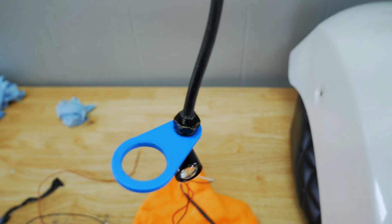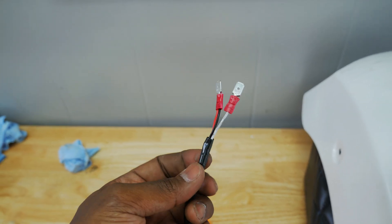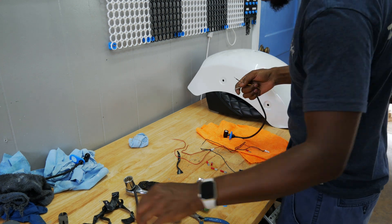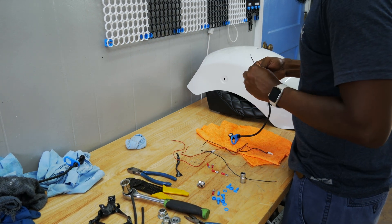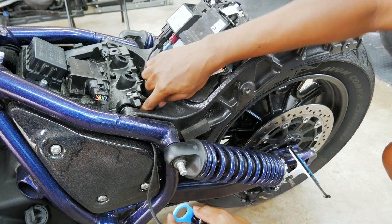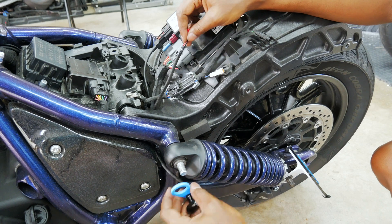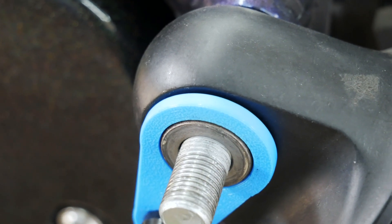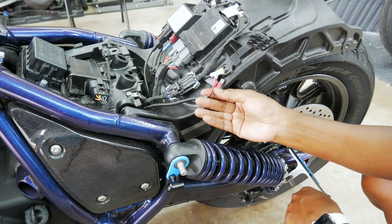The way I'm wiring this up: I'm using the stock Indian harness cover to cover the connector since it's exposed to the elements. Tape them off — red and black together, ground — and the yellow is just taped off in the center. With the wiring done I'll slide this back up through here. Normally I'd do heat shrink tubing and soldering to make it permanent, but I may end up changing these out, so I don't want it super permanent. It just slots on — the diameter is actually 21.5 — fits perfectly on there. I'll clamp the other pieces on, tape them off, bridge them in, and we're good to go.